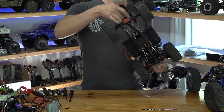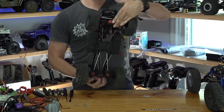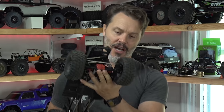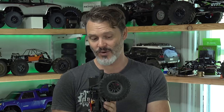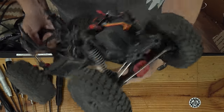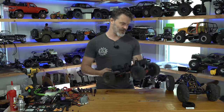On a stock rig you really can't do much except for that upper rear link mount. You can't really do a front link mount because either you have a servo mounted on the axle getting in the way, or you have a servo on the chassis and you can't add anything up top or the suspension won't compress. We're limited by the geometry of the three-link in this case. Fortunately, the front anti-squat is really not that big of a deal. You can change the roll center by changing your link separations at the chassis or at the axle.